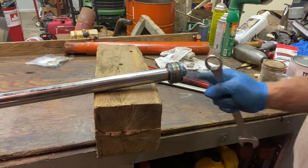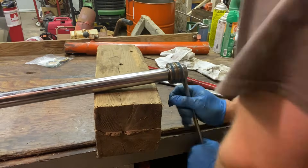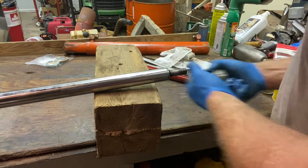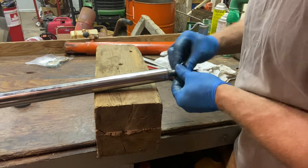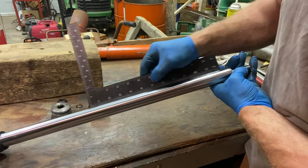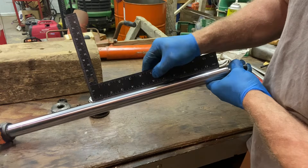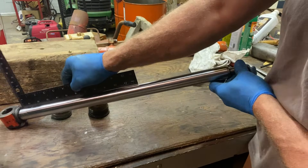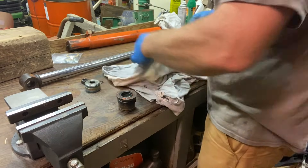This nut is 24 millimeters. To check the rod isn't bent, put a straight edge on it — it'd be nice to have a long one, but the rod looks really straight. You do this in multiple locations by just keeping turning the rod. It looks good. You want to keep everything really clean.